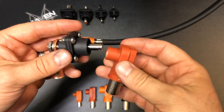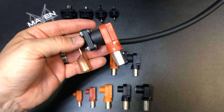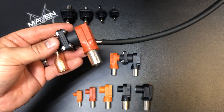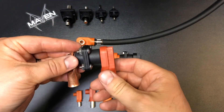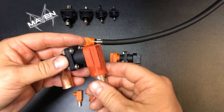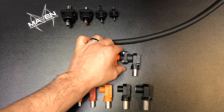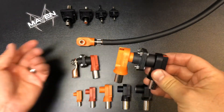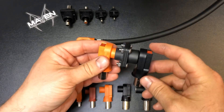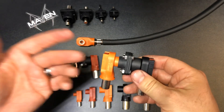It creates a good contact. On each side you can hear the click when it goes back together — both crimp-style connections. Any standard way of crimping battery cables seems to work pretty well for these connectors too. Type B is basically the same thing. Both kits come with stainless fasteners and a template to get all your holes lined up and punched into your firewall, and this one is simply a RadLock to RadLock connection on each side.